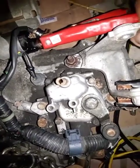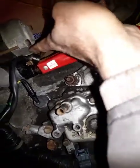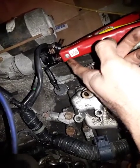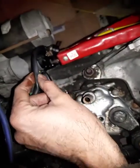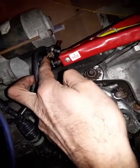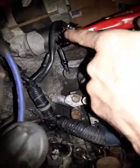So this one, not the one that's going inside the starter from solenoid to starter, no. Put it at the beginning of the solenoid, that one, and we have to give 12 volts to this other thin wire. This is coming from the ignition switch, the ignition key. We don't have any ignition key here, of course. Everything is open. You can see this is the wiring harness. So we don't want to do that. We want to directly put 12 volts there.